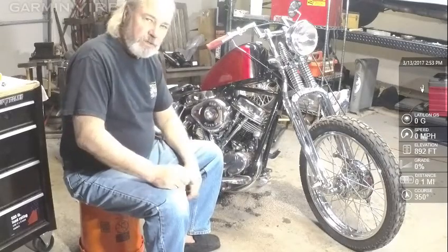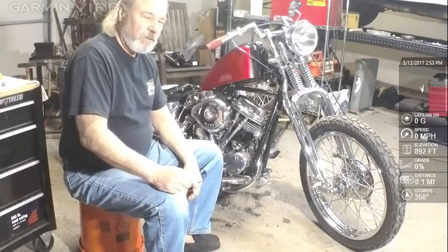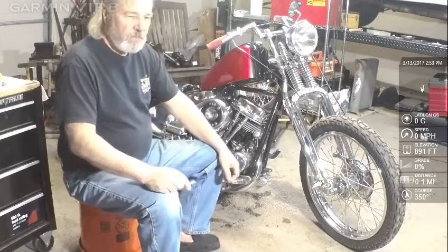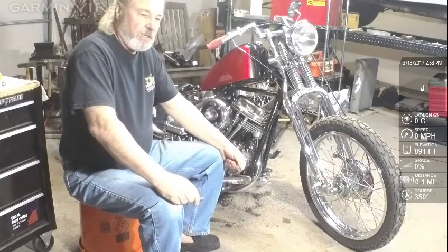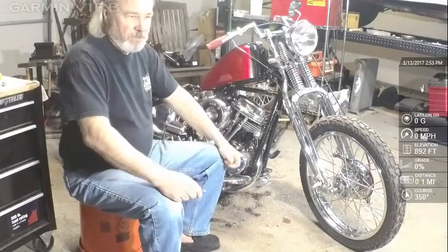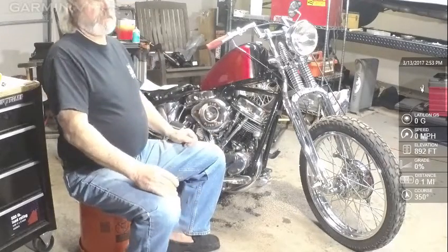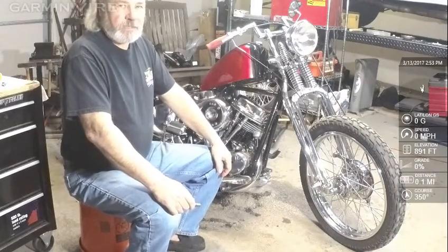There are more modern systems. If you want to get more modern, if you're a racer or you want a better idle, there are reasons why you might want to go to that. But I'm just doing it on the basic level. It'll start easier, I'm hoping, than a point system, and run without any of the points problems. Actually, points ran pretty well as long as you kept the RPMs down. And these bikes don't rev up high enough to cause points problems that way, but the racing engines did.